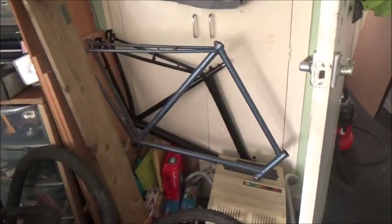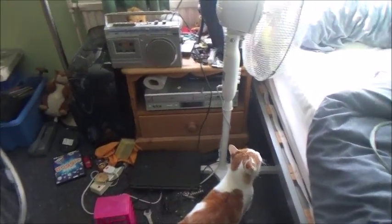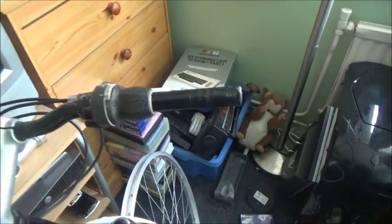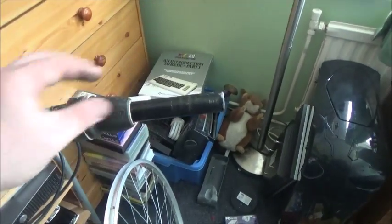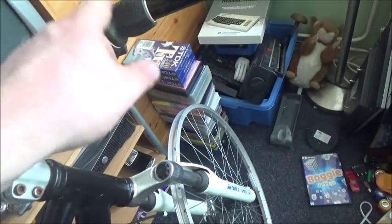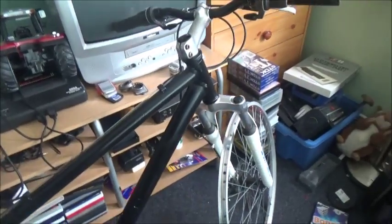I suppose I could make a start on the black one over there if the forks I've got will fit - have two on the go and complete two on Thursday. So I've got the handlebar stem there, the forks out on the landing. The reason I haven't put the handlebar grip on this side is because I've got to pop this off so the grip shift can slide that way to get the gear cable on. I've got to pull this back, poke the gear cable through the plastic frame here, then pop this whole assembly back on. So I deliberately left that off.